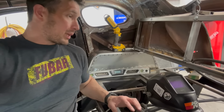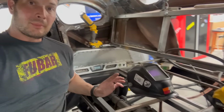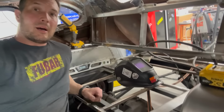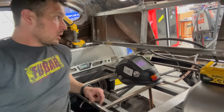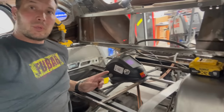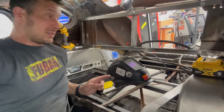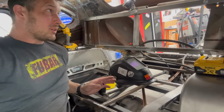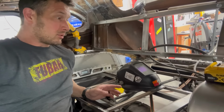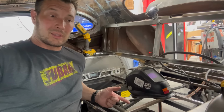So what I'd like to do tomorrow when I get some time, I'm going to come and try and put my supports here, and then I'm going to put some sheet metal on where the seat is going to go to kind of finalize this rear seat area. Then we have to put some metal in the trunk, so as I said, I can put my compressors and tank in there. So they're kind of in the car where they need to go. That way I can also hook the airbags up. Not that they have to go up and down a lot, but at least then I can lift the car a little bit just so I can move it around in the garage easier and not have it on the casters.